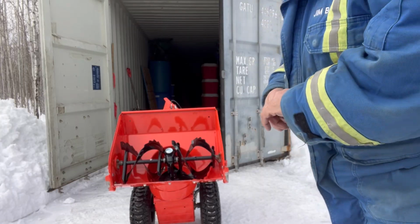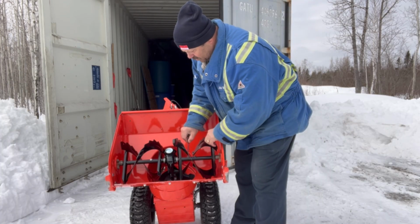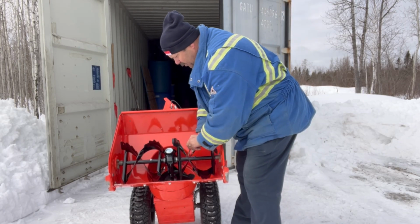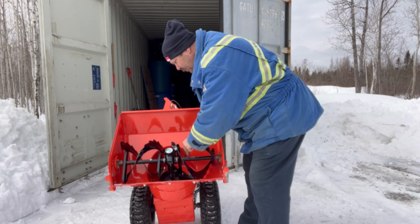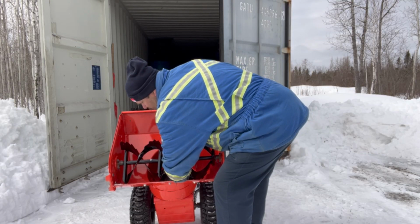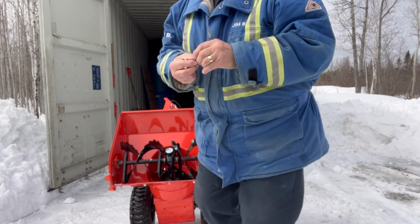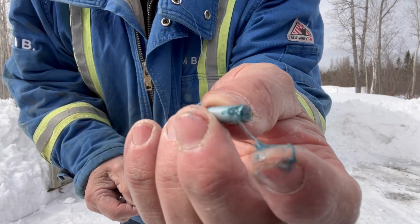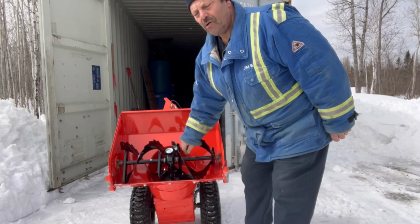First of all, you get your hammer and you try to find out. You've got to pound that thing out. Oh, there, it just fell out. So my bolt broke off, the same thing. The whole entire thing sheared off. The nut fell off, and the other end fell off, and the pin was stuck in the shaft. So I used my punch, I pushed it out.